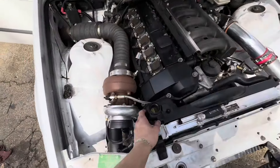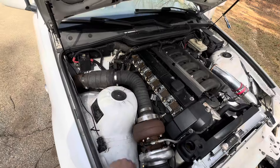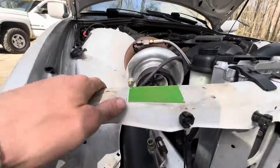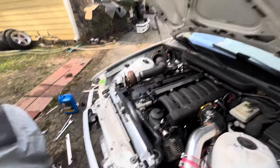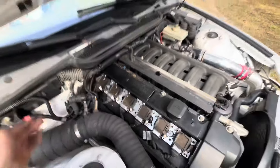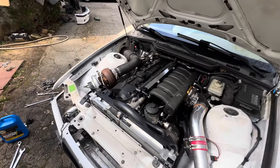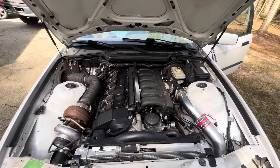Just got this thing back together, letting it idle now - trying to get some bubbles out of this cooling system. It's going to take a while for the thermostat to open. This is how everything came out - tightened pretty much a lot of stuff and I'm more confident in this build now. Also changed this wastegate line so hopefully it actually opens now. Turbo spinning at idle which is a good sign - good fuel pressure. I did try and crank it up earlier and had no fuel pressure, instantly knew something was off. Thought maybe welding around the ECU grounded something out, but turns out there was a ground wire missing. Put that ground on and it started right up - idling really good, no smoke or anything. Pretty happy with it. Just trying to bleed this and we're gonna go for a quick drive - nothing crazy, not gonna hit any crazy boost. Just want to make sure the AFRs are decent. Now that we actually have a cooling system we can actually go down the road. Might drive it to the auto parts store and buy some power steering fluid.